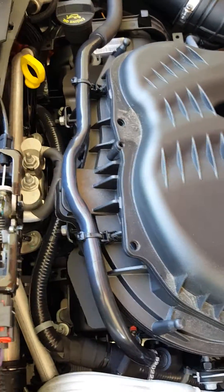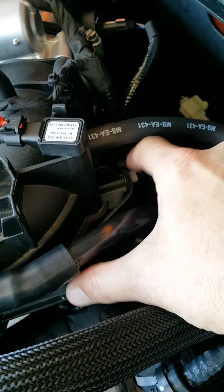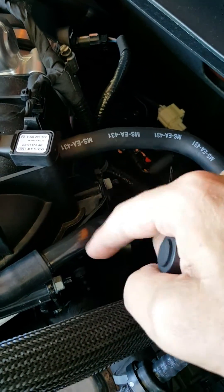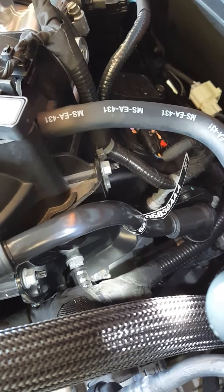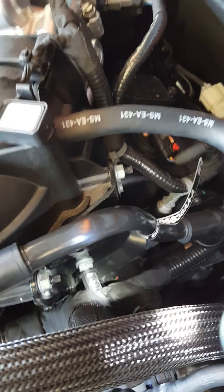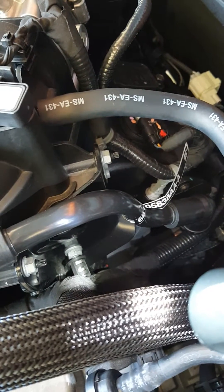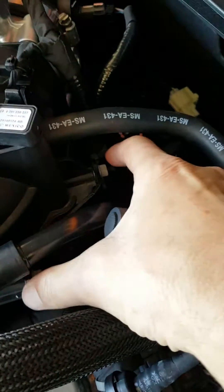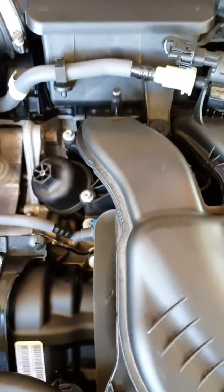There are two in the front and two in the back on the rear. This is a bracket that extends this far — this is the key to it. Once you remove those 10 millimeter nuts, look down there — you can see that bundle of wires has just a holding point which slides onto that. Slide that off. There's a half inch nut — unscrew that and the entire stud will actually come loose. You don't have to remove it unless you want to. That will allow this bracket to become loose. You're almost there — at that point you have seven 8 millimeter bolts.